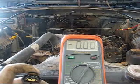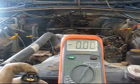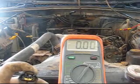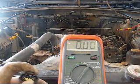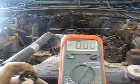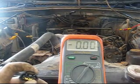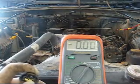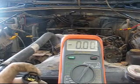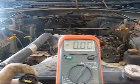So, from there on out, first thing we do is turn the ignition on, and we're going to measure the 5-volt supply. We're going to use pin 3, which is this very last pin here. You're going to stick your positive lead, the red one from your multimeter, into this pin. These cavities are kind of small, and you want to make sure you don't stretch them out, because if you do, they could give you problems later on because they're not making a good connection. What a lot of people do is get a paper clip, bend it out, and stick the end of it in there. I actually have a connector set that you can get from Matco or Snap-on that gives you the correct size pin to go in there. But anyway, you put the pin in the 3rd cavity, and then your negative lead you want to touch to a ground. A battery ground is the way to go.